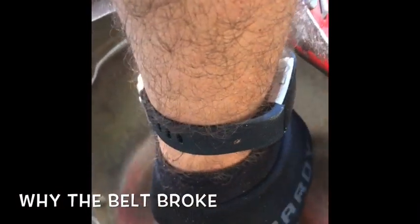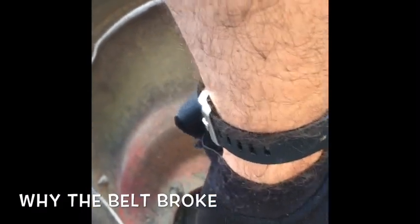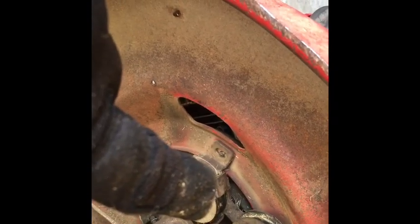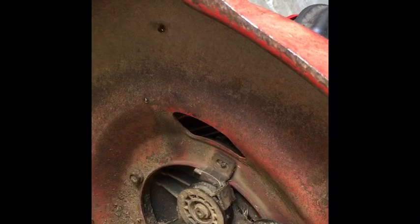So I'm thinking what happened was these spindles or pulleys froze up, and then the belt was just moving across them and not turning them, and then it heated up and melted over time and let go. So I'm going to take that number off of those, see how much the belt costs, and see if I can fix this. Maybe there'll be another part too. This is just diagnosing it.